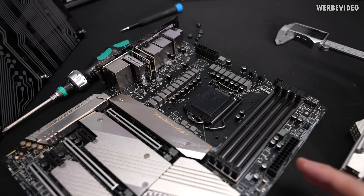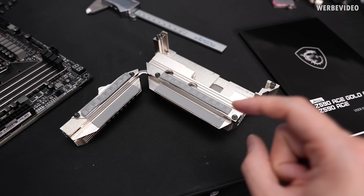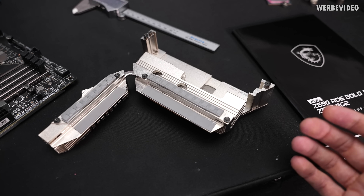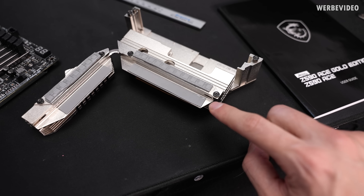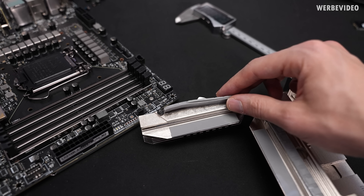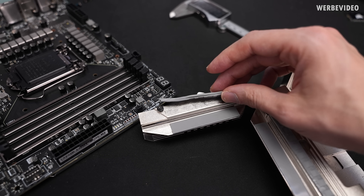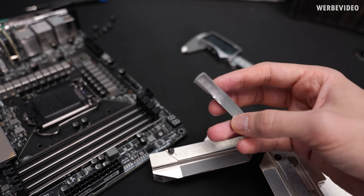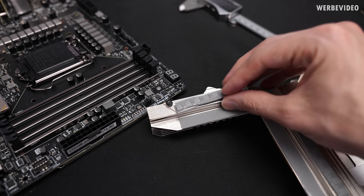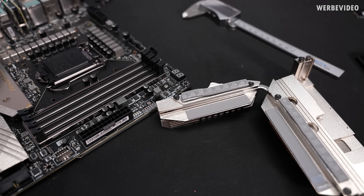I was mid-disassembly removing the heatsink to check it out and measure the thermal pads, because a lot of people are asking if I can check the thermal pad thicknesses so they can replace them with higher grade ones. The one on top is 1.5mm, the next is 1mm, also 1mm thick. Then I checked this one — what is this? It's like two pads stacked, not even perfectly stacked. This reminded me of all the stuff Steve discovered when it comes to MSI and thermal pads. That's not good, that's really not good.